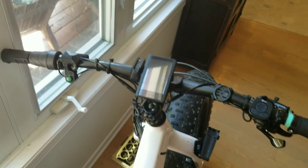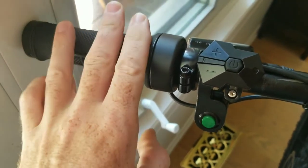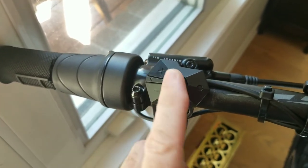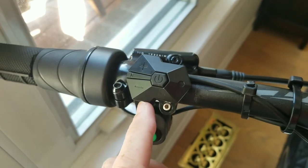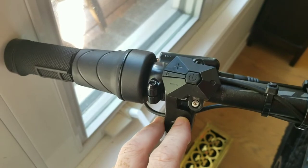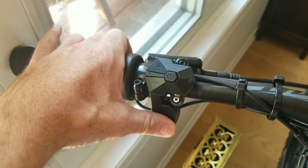At the front of the bike we have the control system. We have a twist throttle — I've cut the original handle down to fit that in so it spaces correctly on the bike. These are the controls that take you power on, and then up a level on the pedal assist and down a level on the pedal assist. This is a cutoff switch run to the other brake cutoff input. If there's ever any problem, you can also use it to change gear — you just push down the bottom and it cuts all power to the motor.